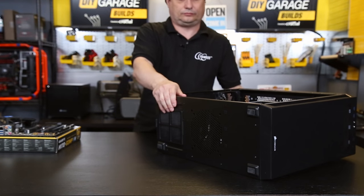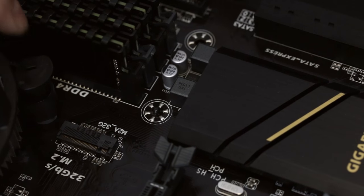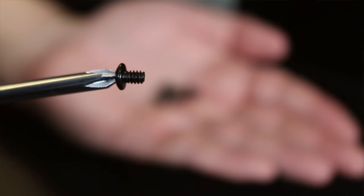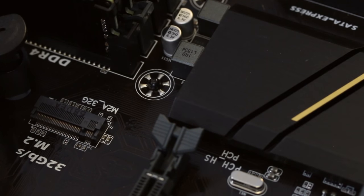What we're going to do is what I call a dry fit. Lay the case down onto its side, and grabbing the motherboard by the heatsink — which is the safest place to pick it up — line up the ports with the I/O shield, slide it back into position, and then look through each motherboard hole to verify you can see the standoff behind it. What we don't want is a standoff that doesn't line up with a hole. If I counted seven standoffs and only have six holes, there's one hidden back there that's probably going to short something out, and that's going to be a bad day. To secure the motherboard, grab the short, coarse-threaded screws from the case accessories bag, get all five screws started, then tighten them down — just snug, don't overtorque. The center hole doesn't accept a screw because it's a special standoff that holds the motherboard in the correct position.